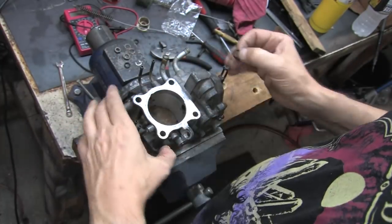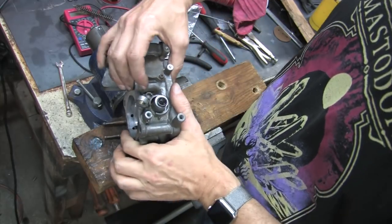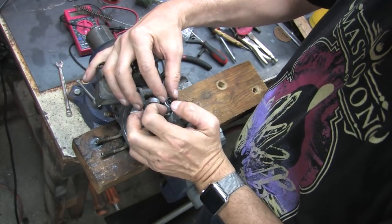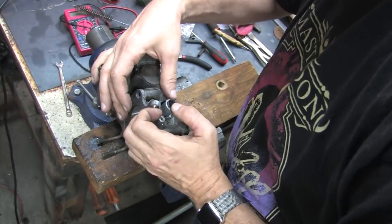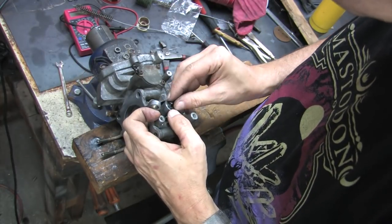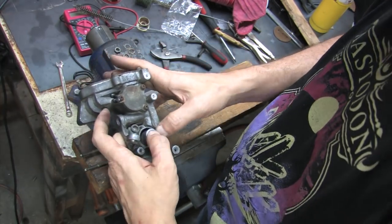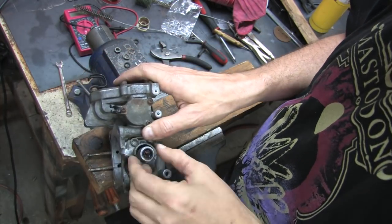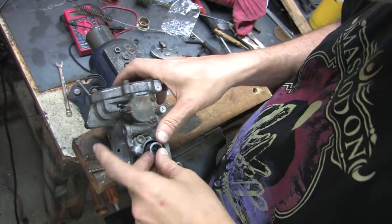You'll never be able to do this with a mil-spec seal, but I like to install the big seals dry, gradually, and by hand. You have to do this with the seal perfectly centered, start with light pressure, and just slowly massage it in there. There are seal installer tools available within the community if you search around, and if I could have found it, I'd be using it right now and linking it in the description too. If one side slips in too deep, pull it out and start over.